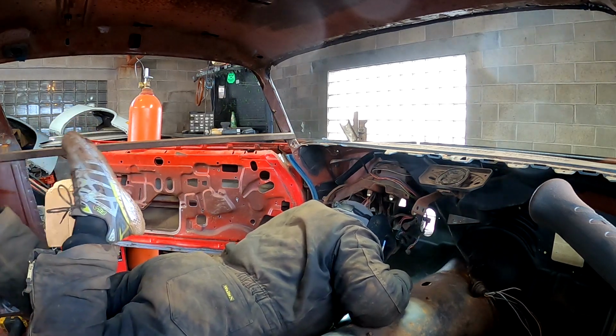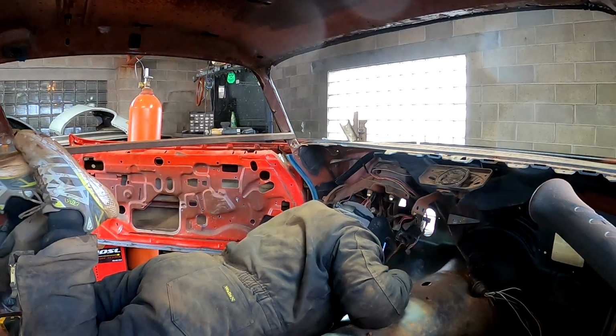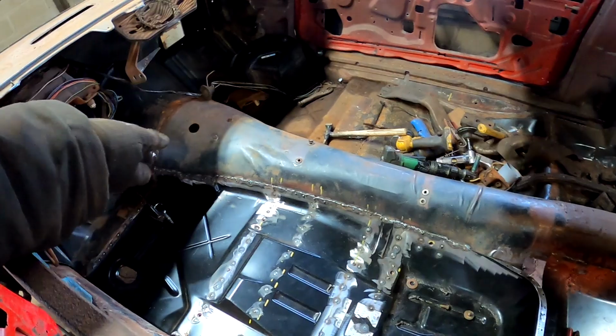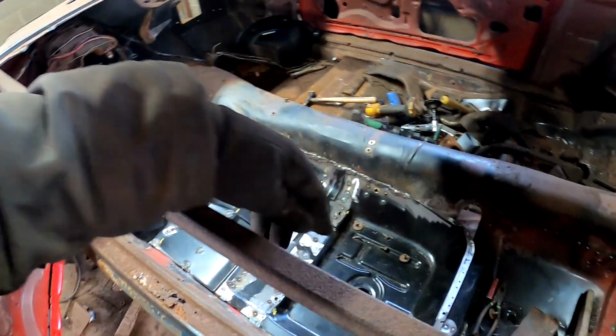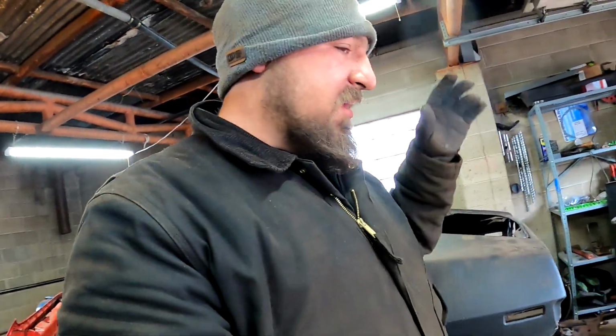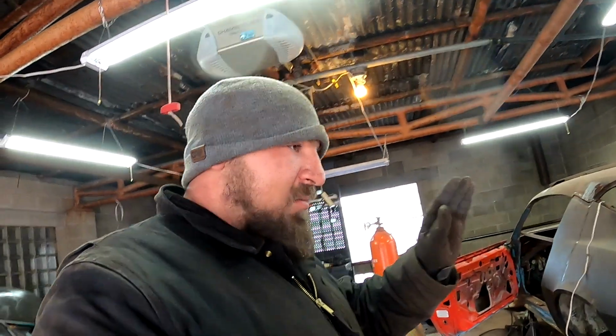Way more comfortable. Floors in, spot welded, seam welded along there, so on and so forth. I gotta finish up welding back here. Not gonna bore you with any more watching me do any more of that, because it's repetitive. Tack weld, tap down, or move a self tapper over a couple holes and put it in. But I'm gonna do that real quick and I'm gonna roll credits. Not really credits, because, well, there are none.